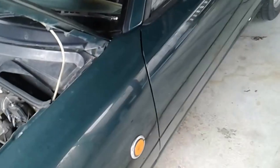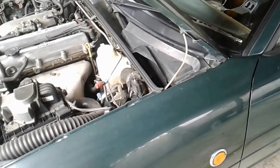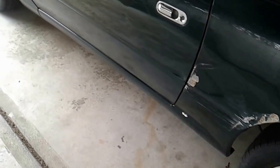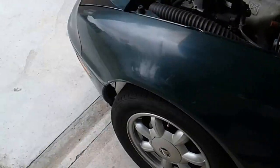The reason I changed these injectors is because the old ones were worn or blocked with crud — the car was smoking and smelling of petrol on take-off. It's also recommended to change the fuel filter, which on this car is under the rear wheel arch under a cover. There's a bit of damage on the side which will be fixed next week. Thanks for watching, I hope this is of good help to you.